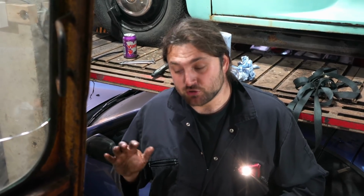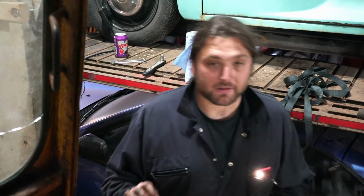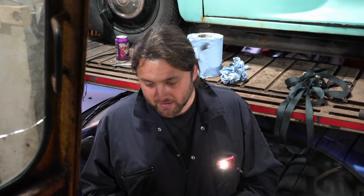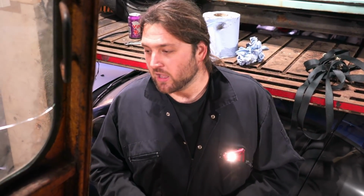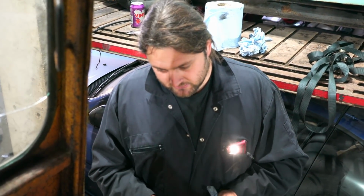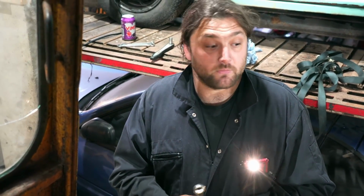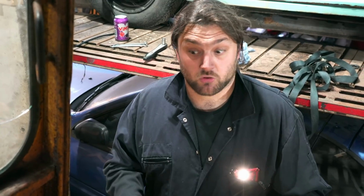It's a tight fit there, and it was made tighter with a hammer and a piece of wood to gently persuade the pipes that they need to go back into place. Now, the fact that they are in place is good, however the pipe has a fairly nasty kink in it, which was there beforehand but it's been made worse, and another one. You know how pipes are normally round, this one's now flat, so they may not last particularly long regardless. So replacements. They're going to be replaced. So much work needs doing on this, if it worked and we could keep it working and then restore it at some point as a rolling resto, that'd be lovely, rather than having to take it all to parts.